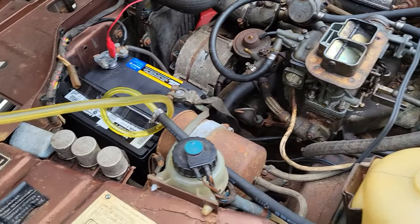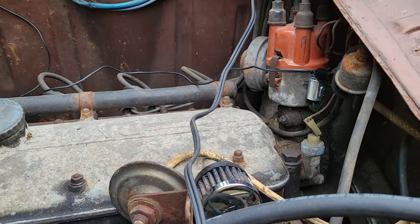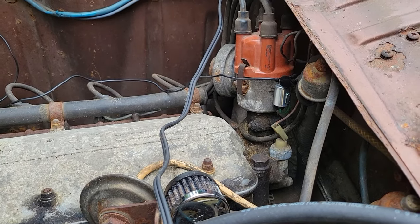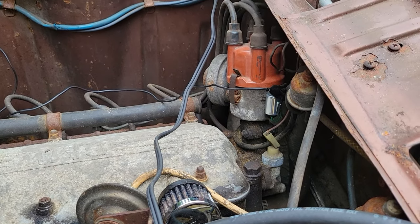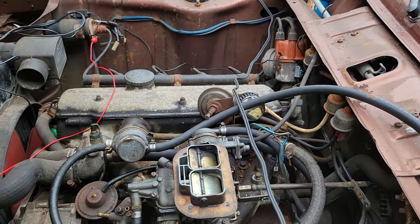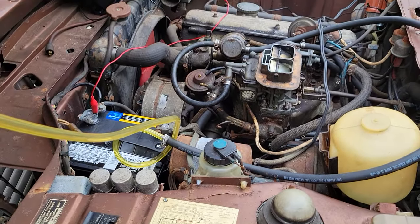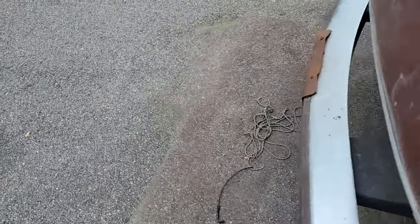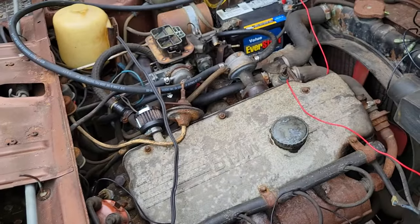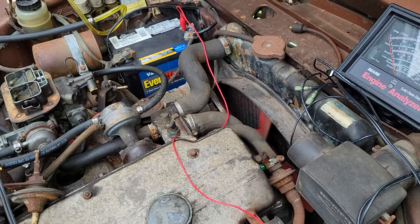Battery's good. You can double-check your gap on your points — I'm not gonna explain that in detail, it's really easy: just take a feeler gauge and find whatever gap your car needs. And that's pretty much it. From here on out we're just gonna start this whole thing. Fingers crossed everything's running.